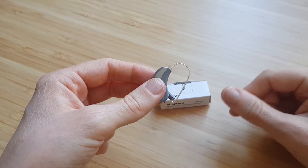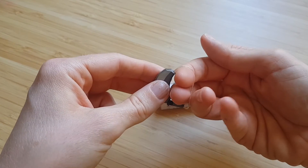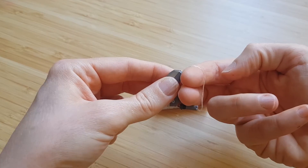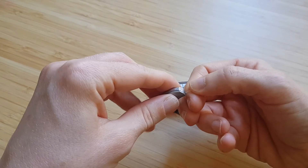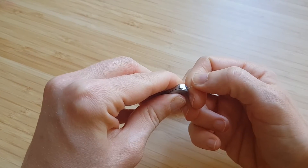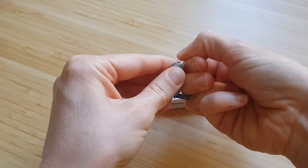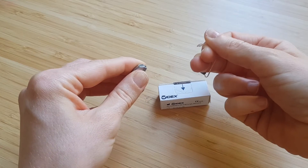To remove one that we think may be broken, the best technique is to just pull it — there's no locking pins or anything. Get your two fingers underneath the wire, use your thumb for grip, make sure you have a good grip on the body of the hearing aid itself, and then just pull upwards. It should come out fairly easily.